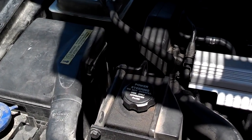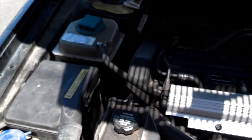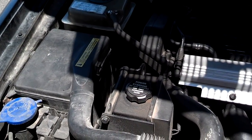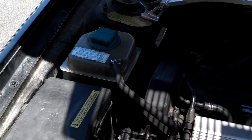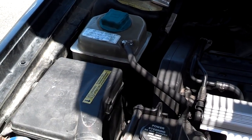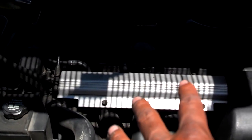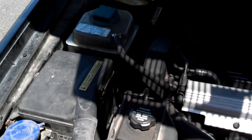Here is a test to help determine if your car has a blown head gasket. When the car is cool, check the level in the coolant reservoir and bring it to at least the minimum mark but not over the maximum. Close the hood, start the car, and drive for 10 to 15 minutes to get it up to operating temperature. Then, with the motor still running, check the level in the reservoir tank. If that level is rising, there's a good chance combustion air is getting past the head gasket, forcing hot gases into the coolant passages and pushing coolant out into the reservoir.